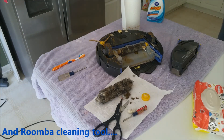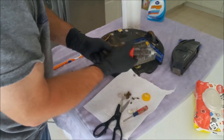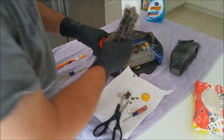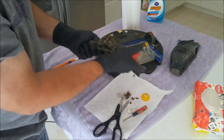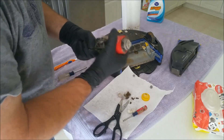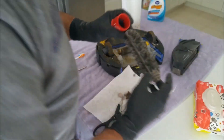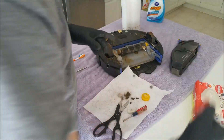Time to get my Roomba cleaning tool out of the drawer. You're going to draw that over the brush, pulling all of the hair out of the bristles. It's important that you rotate as you go down to get a good grip — otherwise it just pulls it into a mass through the brush instead of off the brush. I'm going to repeat that a couple of times. Some of you may simply opt to throw these brushes away. I will actually be soaking this brush in baking soda for an extended period of time. Brush goes into the soapy water, as does the cleaning tool.